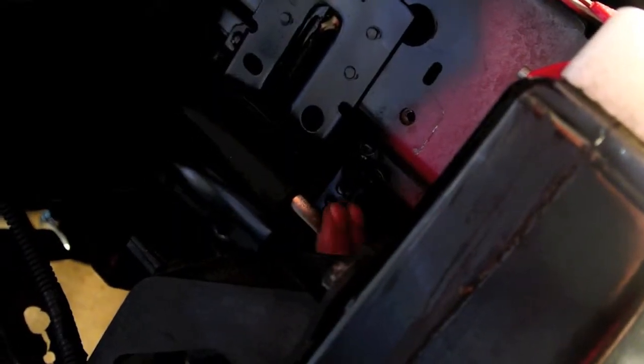In the last mod I had to make, I made a little notch right there to clear this transmission cooling line. The Blue Ox instruction manual says this should take three hours to install. Well, so far it's taken me about seven hours and I'm only about halfway done. A lot of that time was trying to figure out how to disassemble the thing because the instructions in most cases were just flat wrong. Other issues I ran across were rusted-out bolts that busted, and having to fine-tune the base plate by trimming and cutting things until I was satisfied it wasn't rubbing against any transmission lines. To do the job right, it's really going to take much more than three hours - unless you want to rush it and get a rush result.